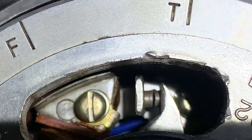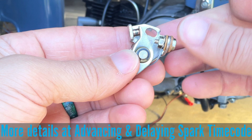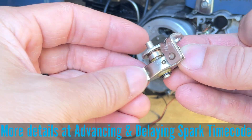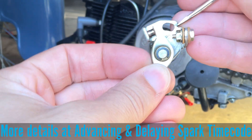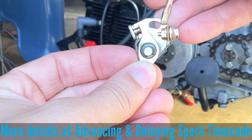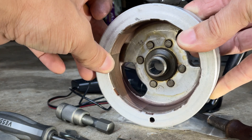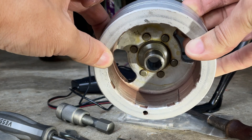Basically, you're loosening this locking screw so you can slide. The whole thing is called a contact breaker. There's a dowel in the middle so you can pivot it to the left or right. That positioning sits when the inner flywheel shaft — which is not a perfect cylinder — hits the lever so the points open.